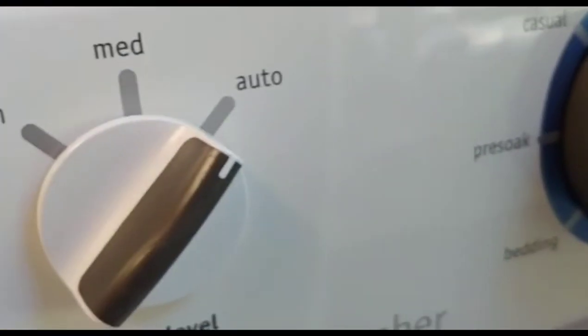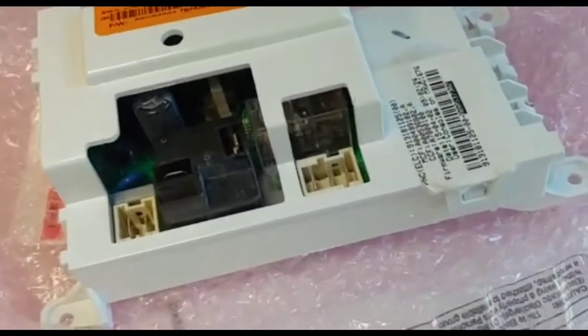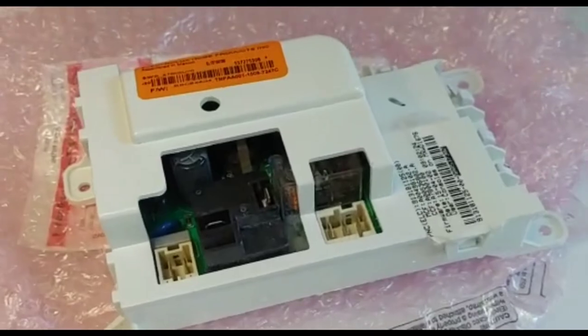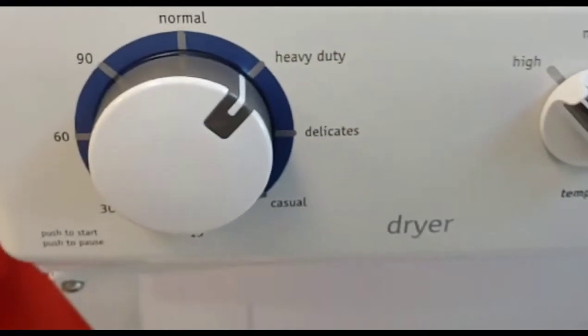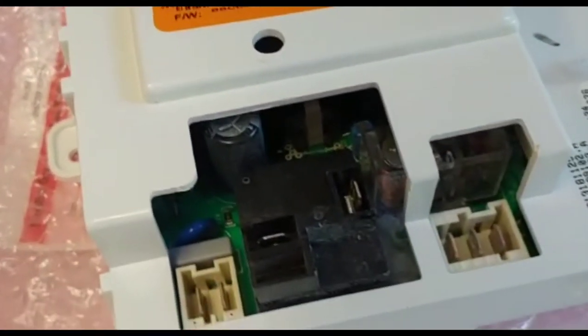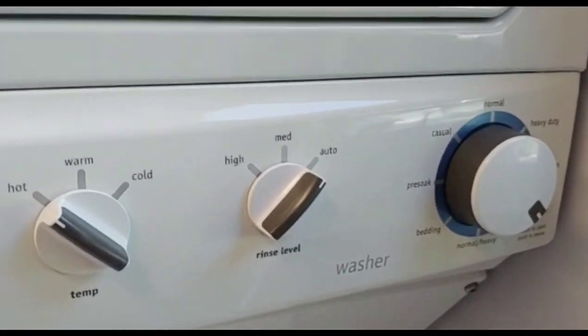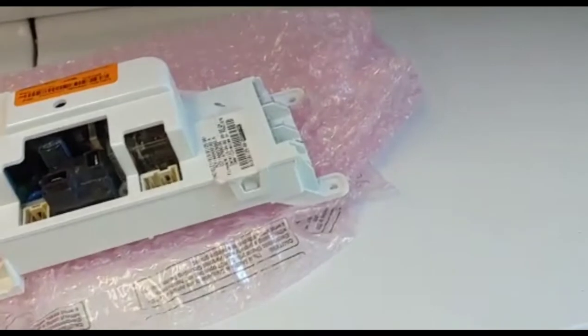I've been having some issues. Not knowing what I was purchasing, the machine was not responding — not really doing much. This particular model is controlled by two computer modules. One is behind this panel — that's the one I bought. I thought it would be for the old machine, but it actually controls just the dryer part. There was no issue with the dryer. What happened is the machine acts randomly: sometimes it's working, sometimes it doesn't, sometimes it fills up, sometimes it stops. I found out it was the computer module underneath — I already replaced that.